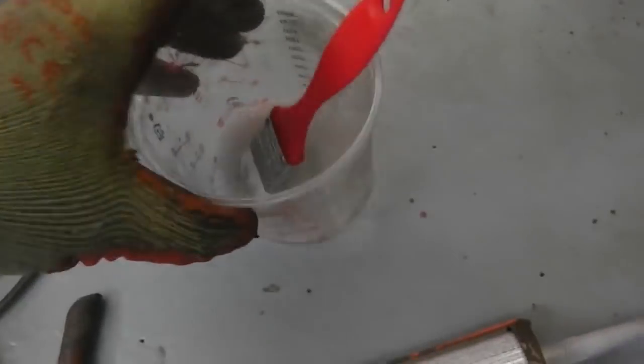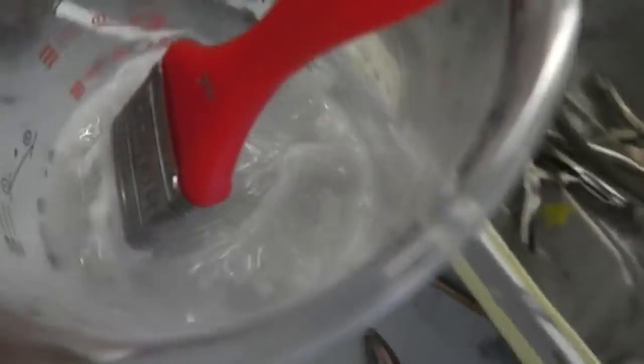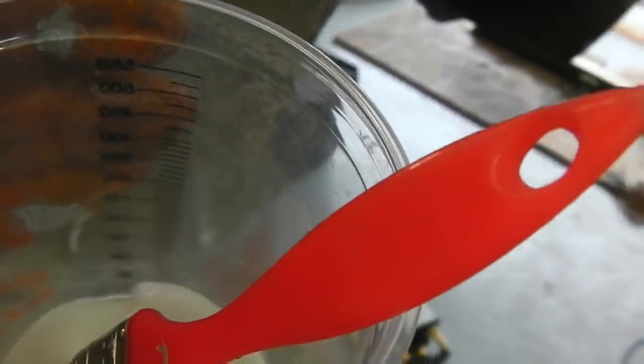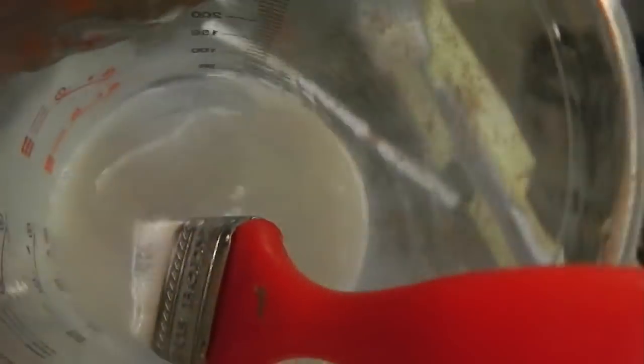No, we're okay, standard thinners cleans the brushes. Don't want to waste them brushes. So yep, you can use your standard thinners in one of these water body tubs, otherwise it'll melt any plastic or a glass jar. You can get these handy tubs from the paint shop, they give you your mixing ratios. We're doing a 1-3 mix on our paint. This is a seam sealer brush just dissolving in thinners, the seam seal coming off it.